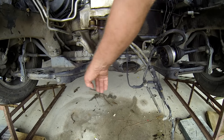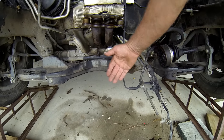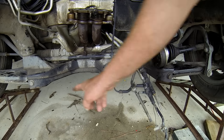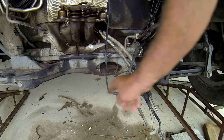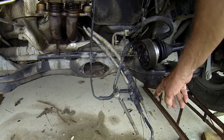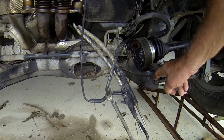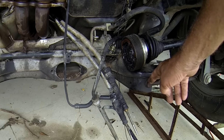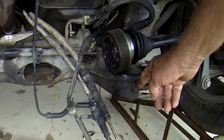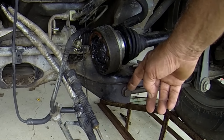I've got to put a steel bar across here for two reasons. One is to mount the back of the skid plate and the second one is to put a brace between those two lower wishbone suspension mounting points. I'll put tabs on here and I'll make them out of about 5mm steel and I'll weld them onto the chassis, because those holes, even in normal road use, can ovalise - let alone when you get on the dirt and put heavy suspension on the car.